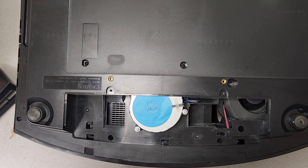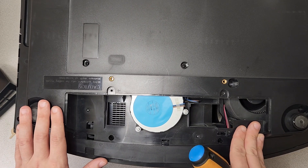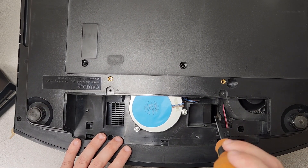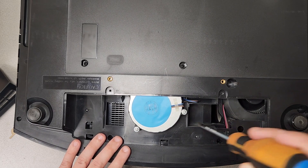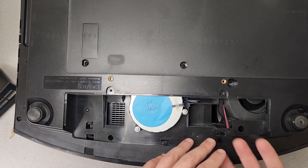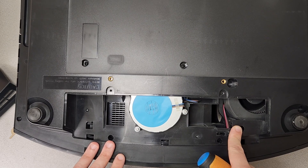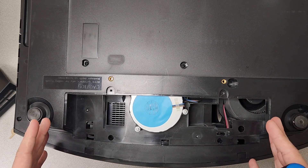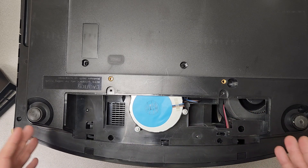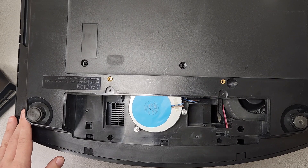You want to make sure that those get cleaned out. The best way to clean out this unit whenever you have it opened up like this and you're inside this maintenance hatch is to vacuum it out. You don't want to blow the dust further inside of the unit at all. The only way to avoid that is to have the top opened up whenever you're accessing this. Really, whenever you're inside this part of the projector, the only thing you can do is vacuum it out — you can't blow it out. The only time you can blow it out is when you have the rest of the projector opened up, which I plan on going over in my next video.